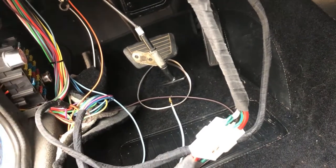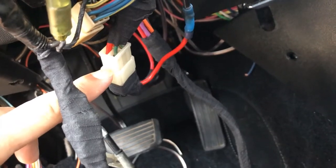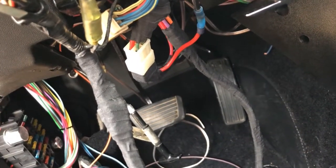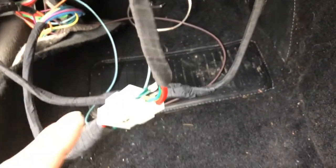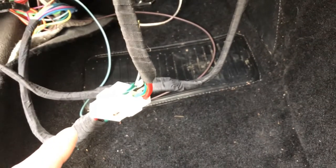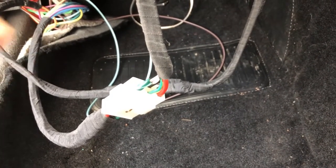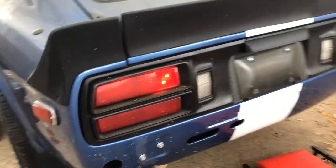The little wiring mess there is starting to look a little better. This is a 4-pin connector I reused, and this is to give power to the lights. I'll post a link to the reference wiring video in the description. I did switch the left and right signals around because the car used in that video was a right-hand drive car, so I got the signal lights working correctly.